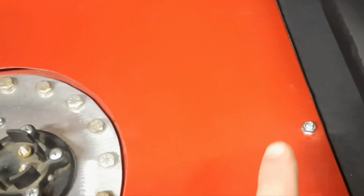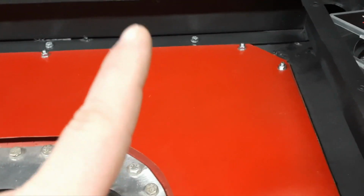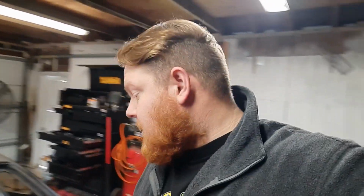The issue arose after I built the box to hold the fuel cell bladder, because the cage was designed for the bladder, and then the box would be put into the cage. I ended up having a space issue. So that's the other thing, if you notice, all the bolts for the fuel cell box or canister or whatever you want to call it, they're all upside down. If you look at almost every fuel cell system out there that has the box, you'll notice that the nuts are always on the bottom side, and that a lot of people build their cages to go around the nuts and bolts. Well, I couldn't do that here, so I flipped all the bolts, put the nuts on top, but then the head of the bolt now spaces up the whole box just by a slight margin.